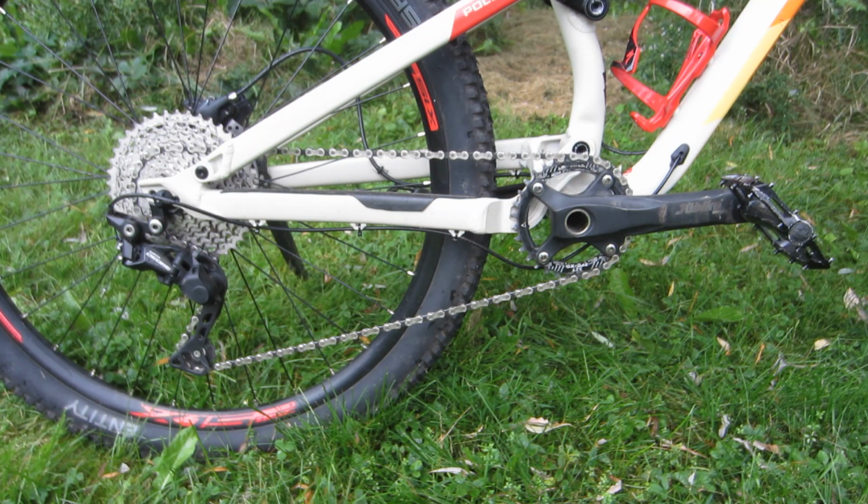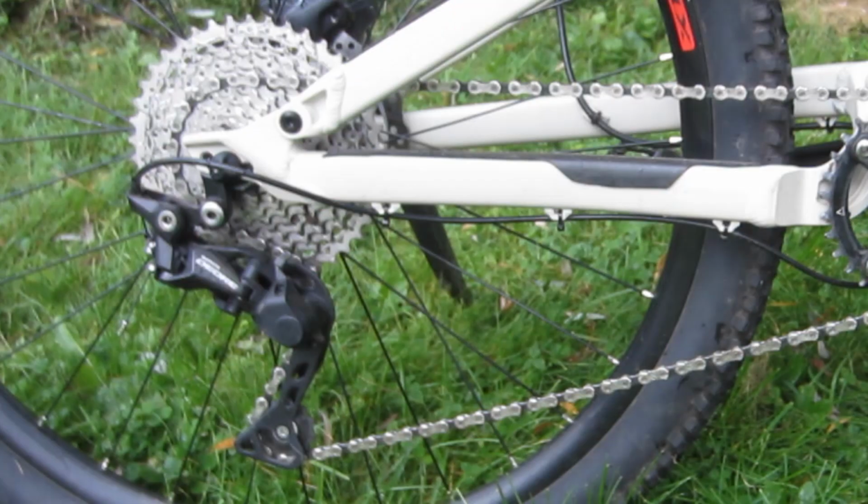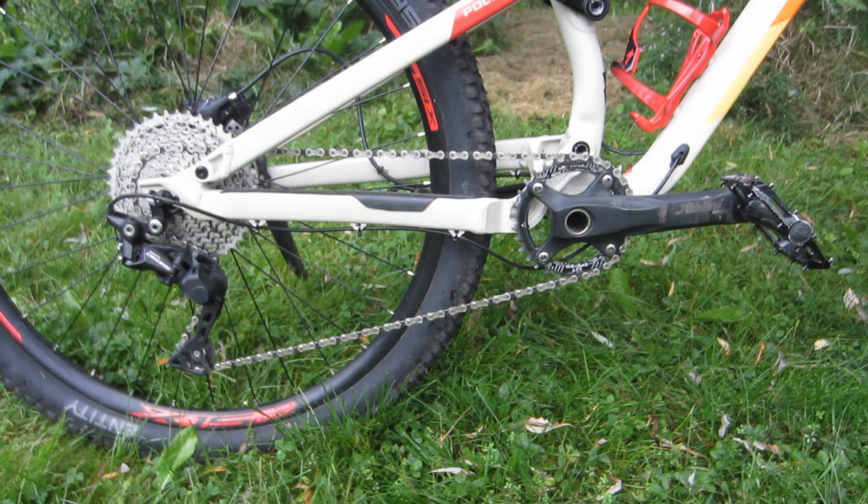Then I replaced the stock 2x9 Alivio drivetrain. I went with a curated kit from JG Bike, and all this stuff is in the description. Basically, I went with a 1x10 with a 30-tooth narrow-wide chainring up front. The rear is a 10-speed Sunrace 11-42-tooth cassette with a Shimano Deore RD-M6000, I believe it is, medium cage derailleur. It's got a Deore shifter up front and a KMC chain.